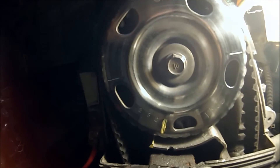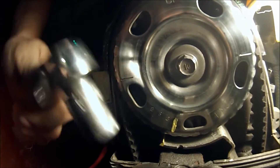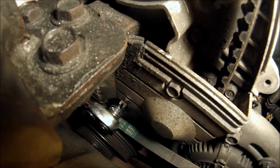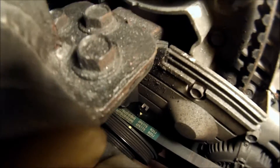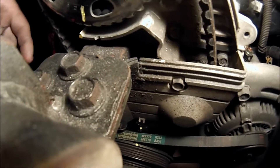You're going to want the 14mm ratchet and you're going to want to remove or loosen this lower bolt down here. I've already pre-loosened it to make the video a little faster — just a few turns to the left to make it loose will do.